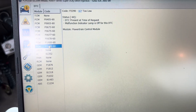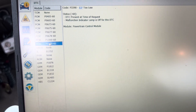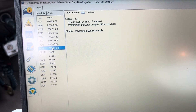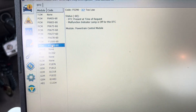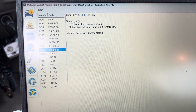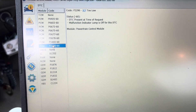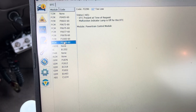This truck's an '03, so it's got the '03-'04 style pump. I bet it's either that little ball valve — sometimes that little ball that sits on the side of the '03-'04 pumps, when that's gone, the low-pressure oil light will kind of bounce. This truck isn't doing that, but I'm pretty positive that the seal in the back is probably blown out.